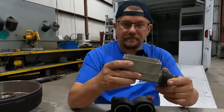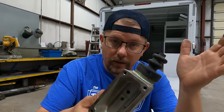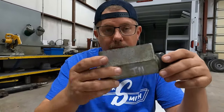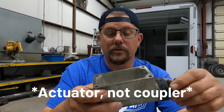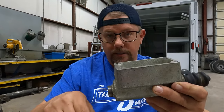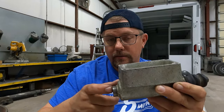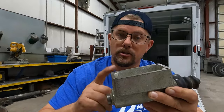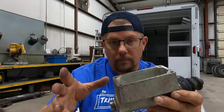Something else important when it comes to the master cylinder: if it needs replacement, this is very specific to the coupler — even different brands run different setups. You're going to need to make sure you get the right one. Also important: many times there is a different master cylinder for disc brakes versus drum brakes, and they will not interchange. If you put a disc brake master cylinder on your drums, it's going to blow the cylinder out. If you put a drum brake master cylinder on your disc brakes, it won't provide enough pressure to work properly.